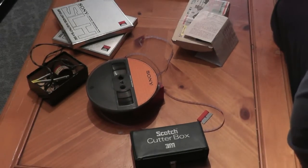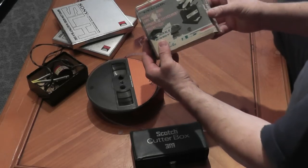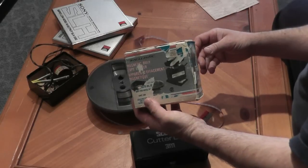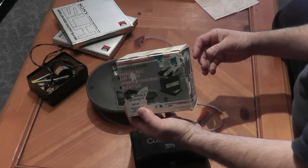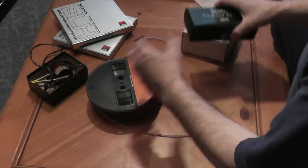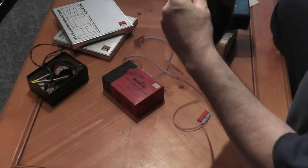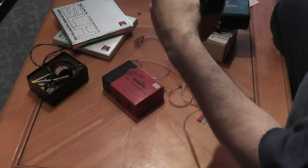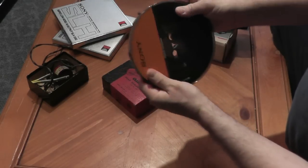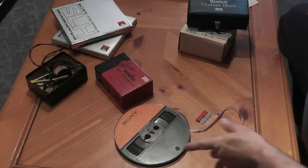The third item I purchased I found in a thrift store for $5.99. It's a Realistic — made by RadioShack — magnetic bulk tape eraser. This gizmo works much like the head demagnetizer; it too is an electromagnet, but a little bit more powerful. What it does is it will take a reel of tape and completely wipe it clean of any music or recording whatsoever. The bulk tape eraser is the perfect tool for that, and it will also work with cassette tapes as well. I'm going to do a quick demonstration.